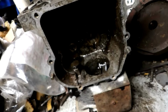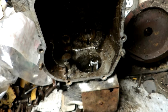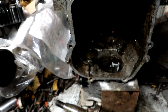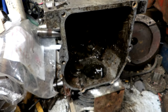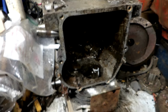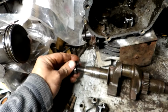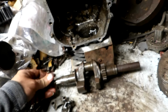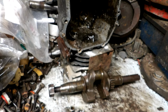So anyway, I'm going to kind of wrap it up there, and I'll try to get the piston out of this thing, and I'll put penetrating oil on the tappets and try to get the valves out, etc. It may well take a press to get the piston out, that or disintegrating it in the bore, one of the two. But at least I was able to save a left-hand thread crankshaft from an approximate 1960 2-horse Briggs and Stratton. So all in all, some decent parts I can hang on to. So it's been a good day.